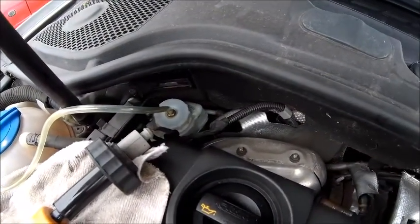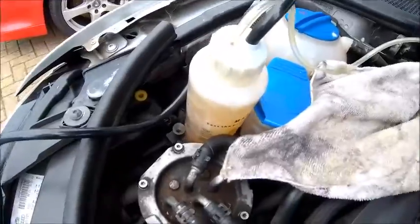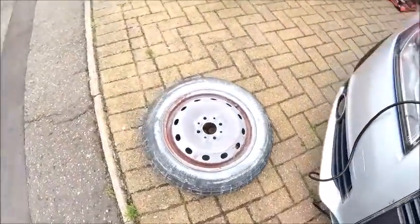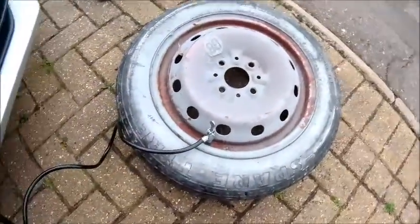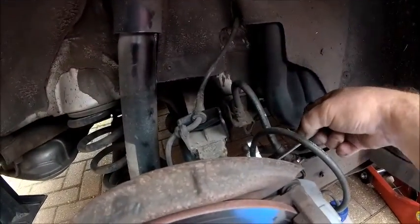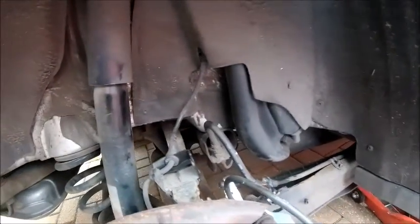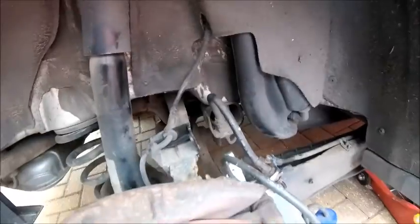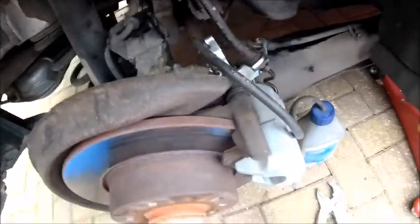So obviously Eddie's trying to make things as difficult as humanly possible. Your reservoir is down there — that does both your brakes and your clutch, and that comes out the top of it. A little bit difficult because of all this stuff on top. My reservoir is there, full of DOT 4. My wheel is down there. So I'm going to connect this up — back to you in a sec. There we go, connected up there, connected up there. Fluid is coming out really quickly, so I'm assuming I left that quite loose — yes I did. So that is it, pretty much. I have bled the brakes. It's as simple as that.